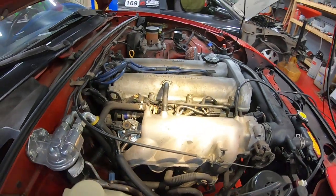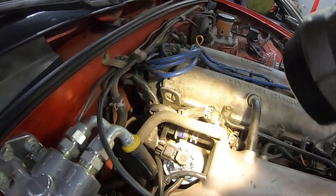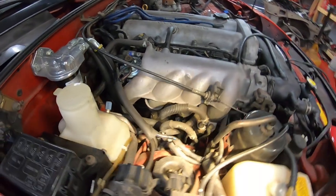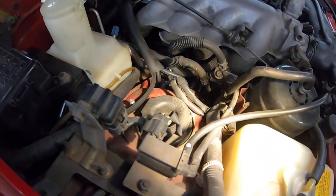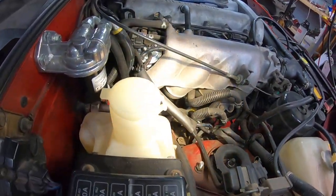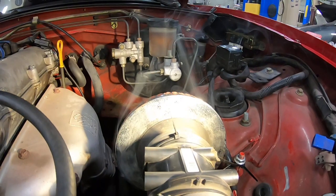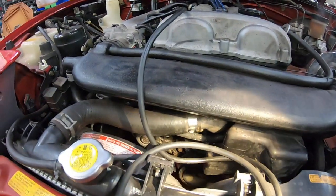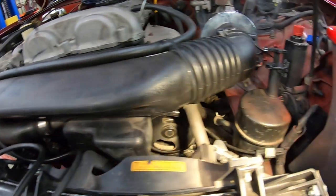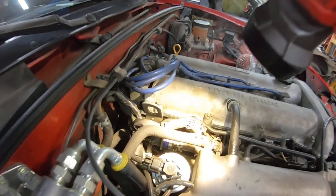I don't actually know for sure that this car has no vacuum leaks — for the previous test we implanted one as a demonstration. We'll basically just keep monitoring, looking around every place the vacuum lines hook up, watching for any little wisps of smoke. As we come over here, you can see the intake — the smoke is starting to come right out of the filter. That gives us confirmation that it has completely filled everywhere in the intake and we don't have any smoke coming out anywhere else.